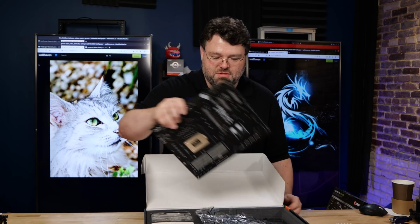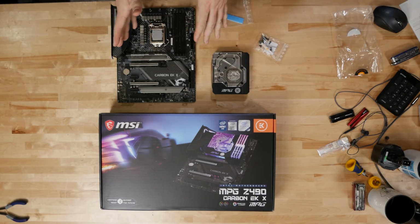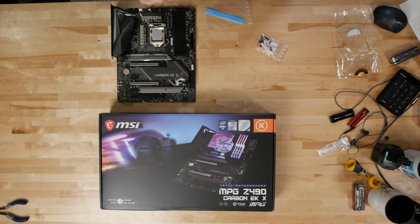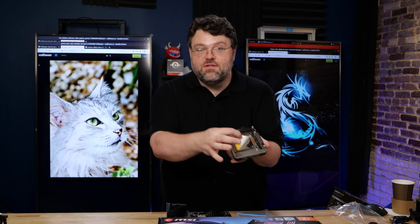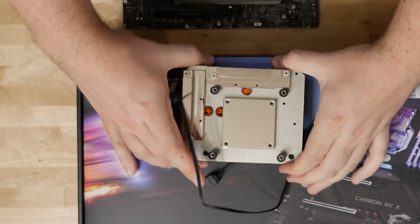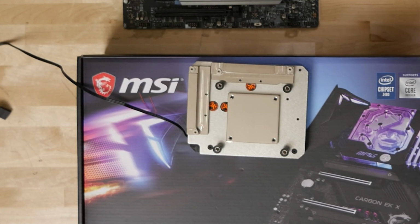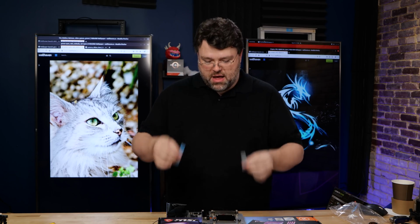Where's my muscly armed throwing processor? It's like, just bam, we'll add a little bit of carbon fiber cooling plate thing. They really want to make sure you don't forget to peel. Also, very important, look, these little plastic spacers, don't accidentally knock those off. Those are critical. You need those. Otherwise, it's crunch. All right, so look, 2 thermal pads.